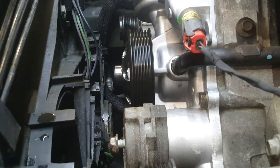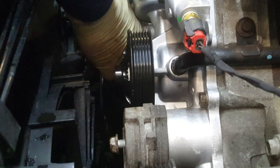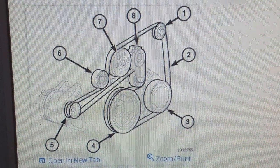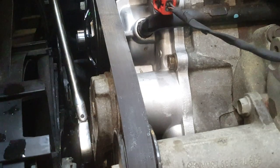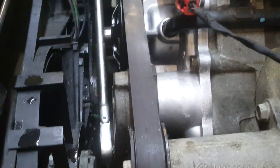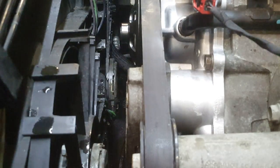We're going to go ahead and install our belt tensioner — that is just a 13mm bolt. Then we're going to install our idler pulley. Here is a picture of the belt diagram in case you need a reference for the direction it goes. We have our belt all routed here and we're just going to apply some pressure to the spring-loaded tensioner so we can slip it over the last pulley. Once we get that on, one of the first things you're going to want to do once you get this thing running is shut it off and make sure your belt is still on all the pulleys properly. I used my pry bar to pop my ratchet out of there to make it a little easier.